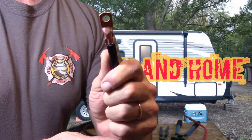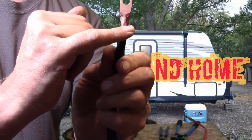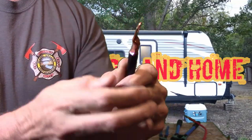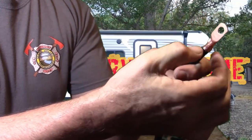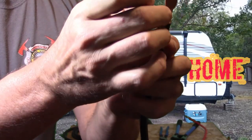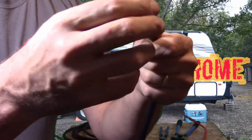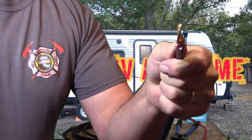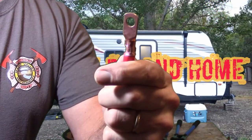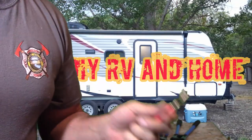Here is my first 4 gauge, and you can see that there is a pinch on either side — that's why I rotated it 180 degrees. But that is solid; it is not going anywhere. The rest of the crimp looks excellent. That pinching part I'm not that big a fan of, but with shrink tube over it everything is going to be good and that thing is not going to go anywhere. The second one did the same thing. There could be some different style lugs out there that this will work better with.